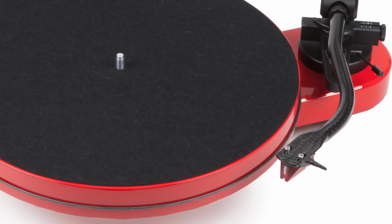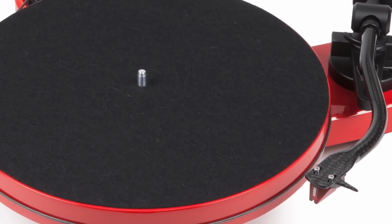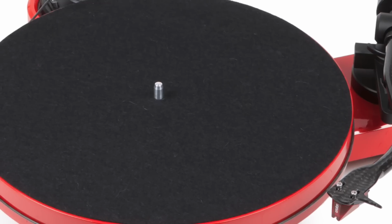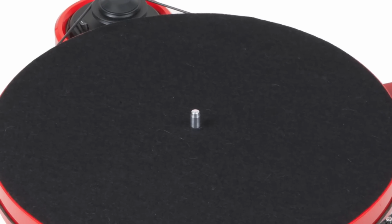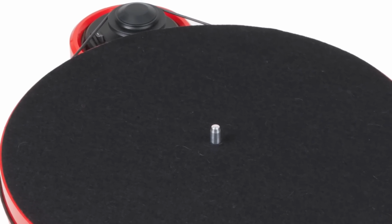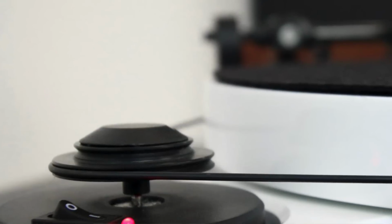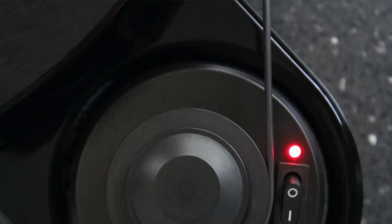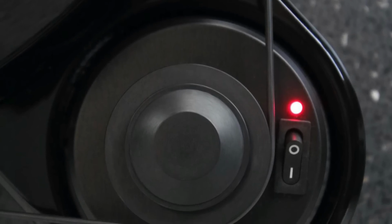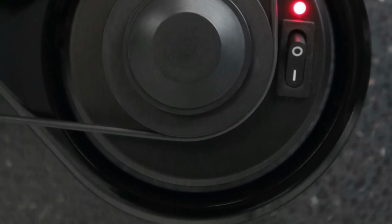The turntable itself arrives with a svelte chassis that, as you can see by the accompanying images, includes a glossy MDF plinth and platter, shaped and trimmed with no excess. A belt runs around the outside of the platter to a separate decoupled motor that sits in an outer plinth ring. The motor has access for a standard wall-wart power supply, and there's a rocker switch that sits atop the motor itself. The platter's inverted main bearing uses a ceramic ball mounted onto a high mass base plate.